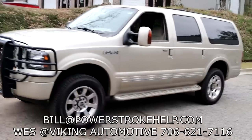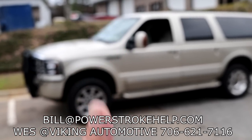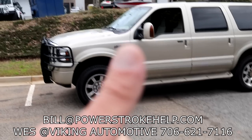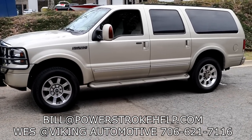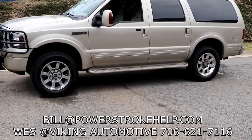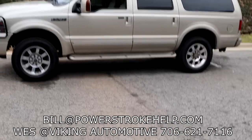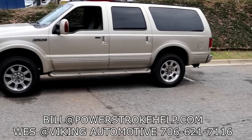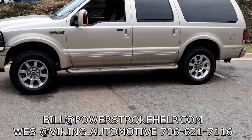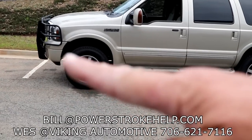One of the things I notice about this truck that greatly affects the caster angle: caster is the angle on which the front wheel turns. Positive caster is like this. Ford Motor Company likes to set it further forward because it makes it easier to back the truck, and at low speeds it's fine, but at freeway speeds when you have too much negative caster it starts to cause death wobble. We're trying to get more caster, but I notice the rear end is a little low. I set this truck up a couple years ago with fairly soft springs for ride quality, but the owner likes to do some towing, so I may not have as strong a spring as I should have. That rear end being low and the front end being high changes the angle of that swing arm underneath.